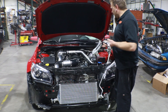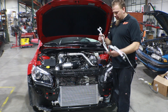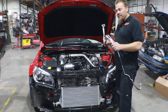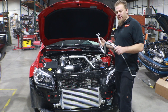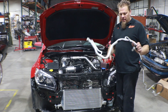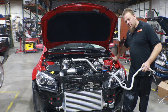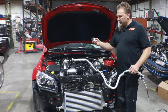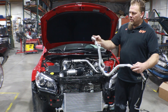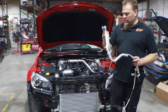Next up we're going to be doing the AC lines here. Now these did change from the G8 to the SS — they used to be two separate lines, but they've actually introduced it so the smaller line actually feeds in as part of the bigger line now. That being the case we can't actually bend these and push them out of the way like we did on the G8. So what we're going to do instead is actually replace them — we're going to pull this whole assembly here off and replace both of these lines with steel braided lines. We've actually made fittings that are going to mock up and simulate this fitting here, and that converts it over to a dash-10 and a dash-4 as opposed to the hard lines that are here.